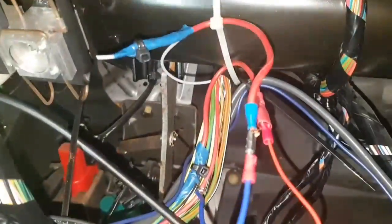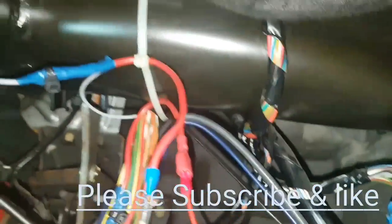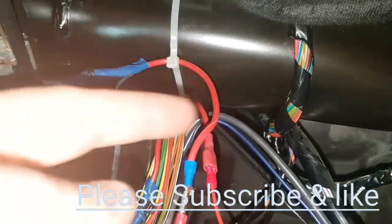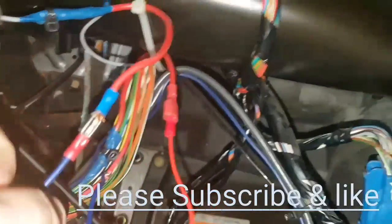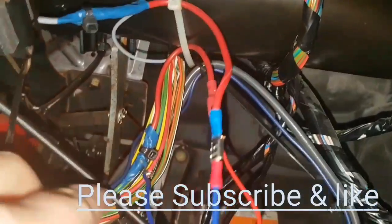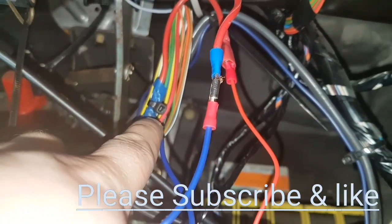All accessible underneath the dash. The red wire is constant 12-volt. The second blue wire goes to the gray wire, which is your crank and ignition. Then your red wire goes to your AC2, which I've taped up here.